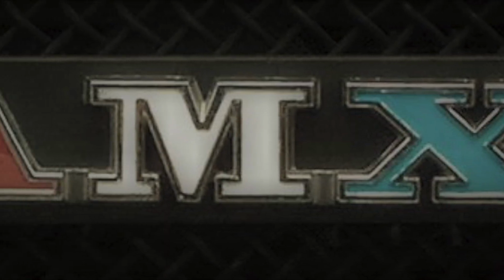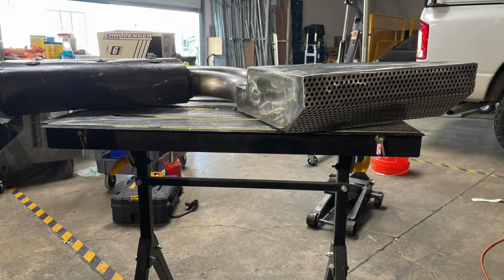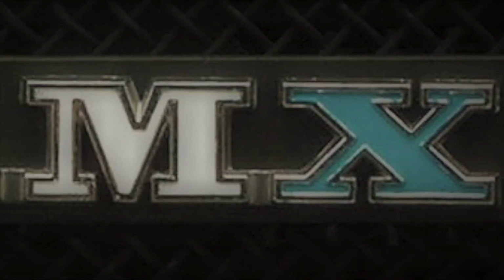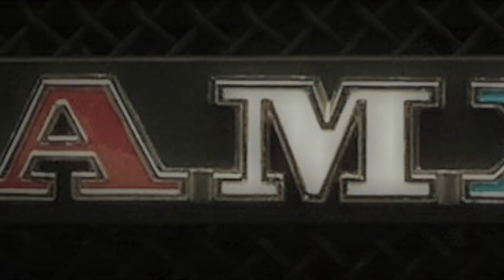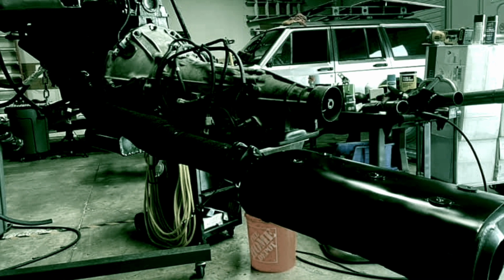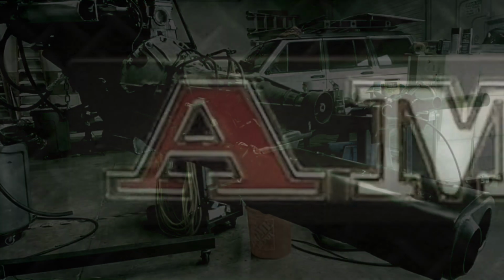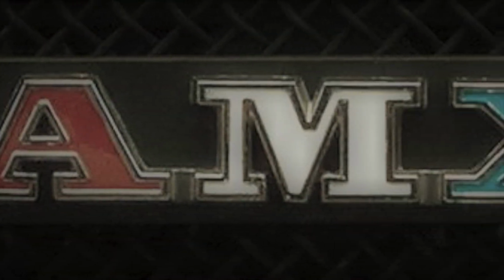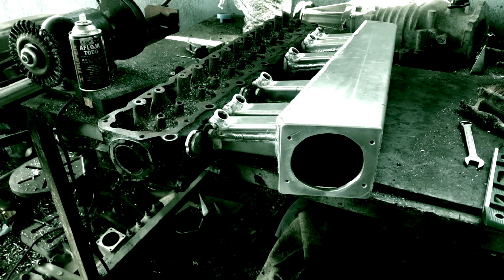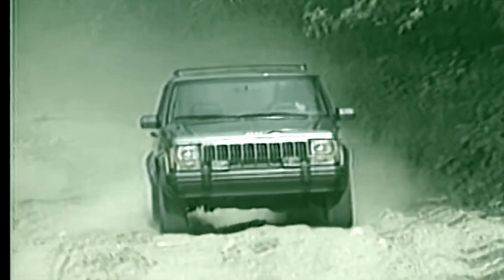Did you ever break one? Yeah. At 246 when it started making power, I broke one. They had a little bit of reinforcement. They hollowed the cap out. It goes up high and then hollows out in the middle and then goes up high again. Structurally and design-wise, it looked pretty good for a lightweight cap. And then they ran it like that and failed a couple of them. So they said, well, that's not going to work. And then they put a little rib in there. If you look at those caps, you've got a little rib going across. Yeah, right in the middle. They put a little rib in there, and the problem went away.